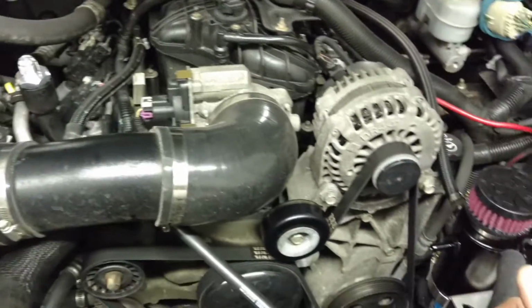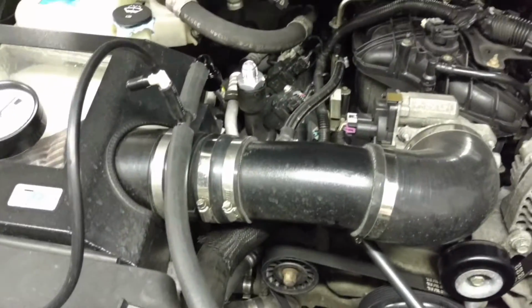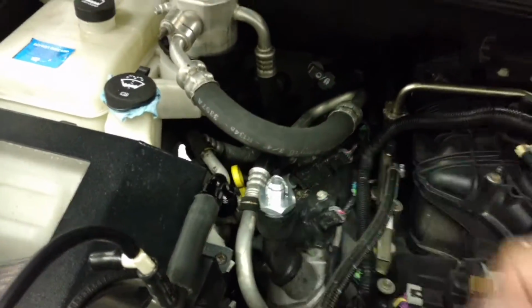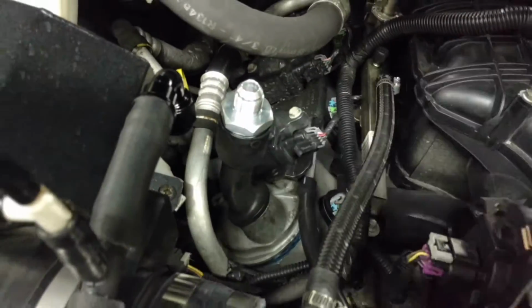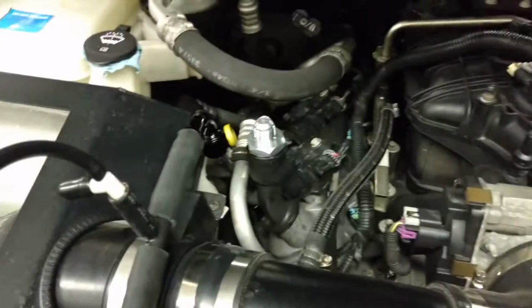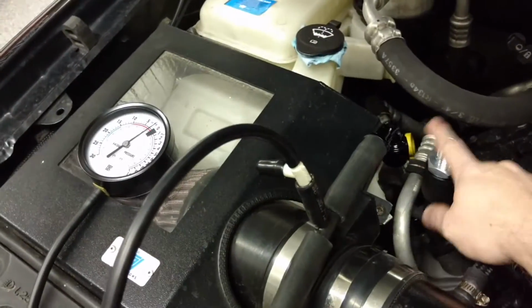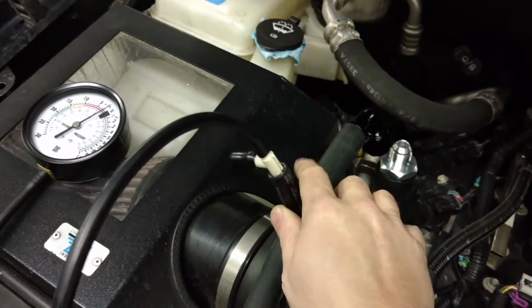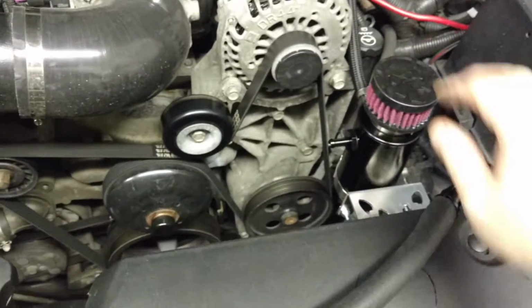So how does that play out on the gauges? So I've got it all set up again. It looks a little bit more weird this time. Instead of measuring the pressure here, I have to measure here where we used to hook up, and that's going to happen at the end of this hose here. Hopefully you can see that that's connected. And then we're checking the pressure leaving the system or vacuum in the system with this number 10 hose that I fabbed up.